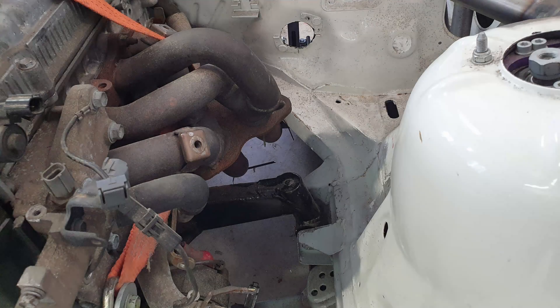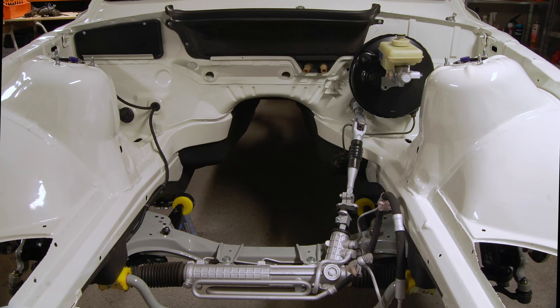You can see in this first photo some of the problems we have to overcome with the lower steering shaft. We have the engine mount that we did fabricate to provide extra clearance, but we also have the exhaust system on this side to deal with. Here's the car with the stock steering system. You can see that the column protrudes from the firewall around 10 cm before it connects to the lower steering shaft with the universal joint, which basically puts the lower steering shaft axis right through where the exhaust needs to go. For our car, we need to move the connection of the steering column to the lower shaft lower, and if possible, a bit more towards the outside of the car.